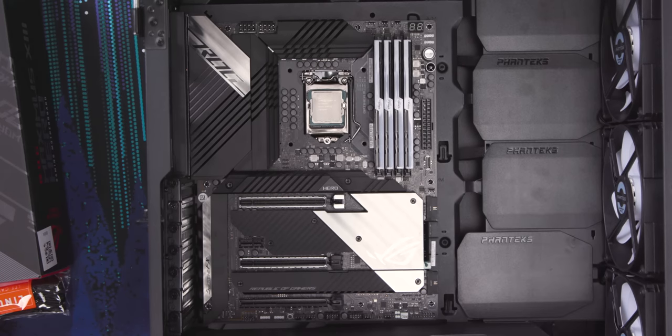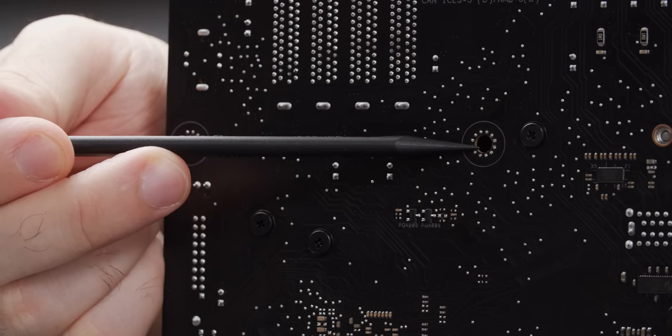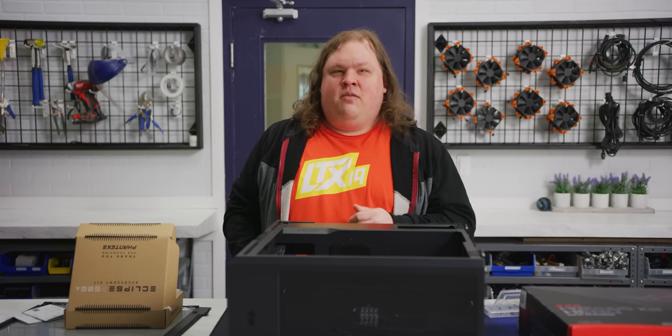Wait, where's our last mount point? Haha! Some motherboards have coolers or armor plates that cover them. While it's okay to simply leave those screws out sometimes, it's really important to flip the board over and verify that there's an actual hole there, because if there isn't, you need to remove that standoff from the case to prevent the back of the board from being damaged.